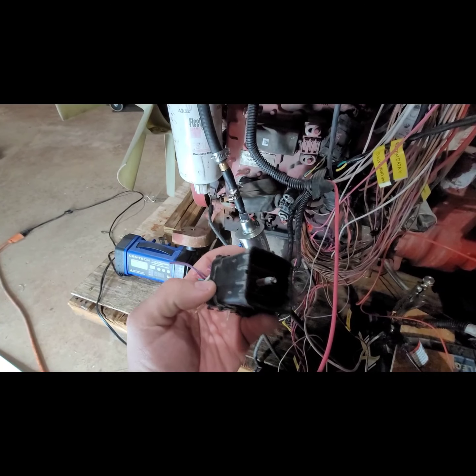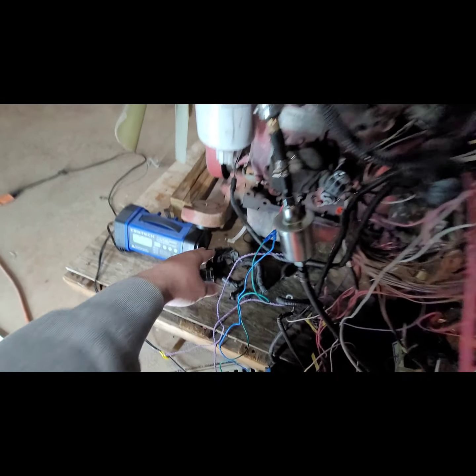So what I started doing here was I got a hold of the wiring schematic. One of the guys over at the local Cummins dealership gave me his actual training document, and it's a breakdown of the wiring harness, and it is very extensive. It actually goes into the plugs, different diagnostic plugs. This side over here is all OEM, so it's going to be more of the chassis stuff, but related to the engine. So a lot of your emission stuff falls in this area up in here. Your battery area, whatnot, is down in here. So it's a little confusing to figure out, but honestly, with minimal work here, you're able to figure out what wires you need to at least make it run to verify.